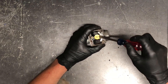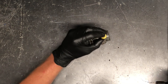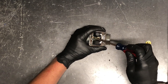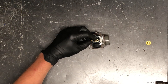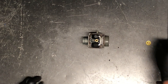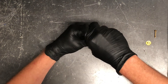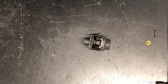You've got your main jet sitting right in the middle here — flat screwdriver to remove that. Then you've got a brass plate on the bottom; you want it positioned so the lip is facing up, like a bowl. There's your main jet holder — unscrew that. You've got your secondary main jet, which is a little bit smaller port — remove that with a flat screwdriver as well. All of these jets: make sure you can see through them when held up to light and blow through them with compressed air and carburetor cleaner. Your pilot jet is right in between the two main jets — it has the smallest orifice. If your bike is hard starting, a lot of times it's because of this pilot jet.